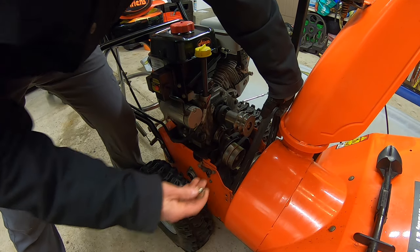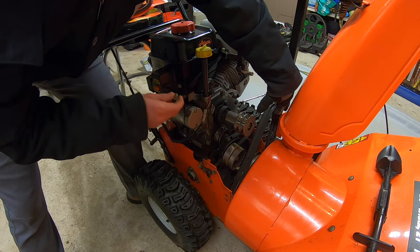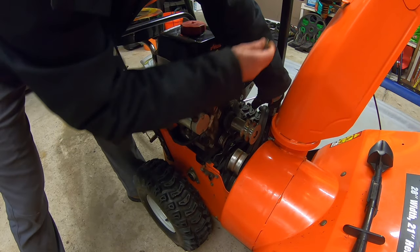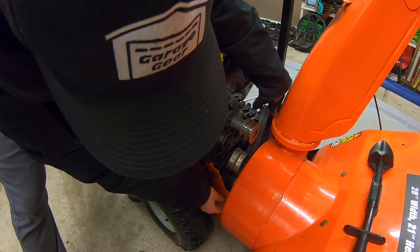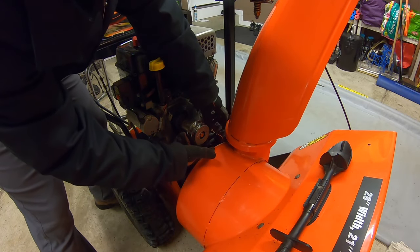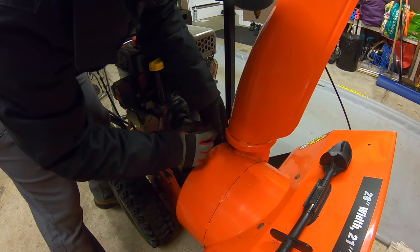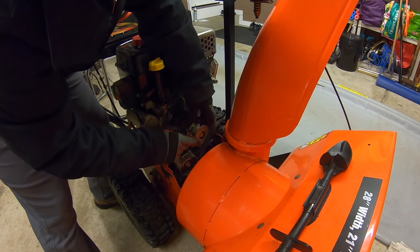So now what I'm gonna do is pull these belts off to the side, push back on this handle over here, tip it back, and then finger tighten one of these bolts into the side. And I'm gonna finger tighten a bolt in on this side. So now the trick here is always getting these belts back over the pulley. So what we can do is a couple things. Number one, we could try to slide the back one over. That one goes on just fine.